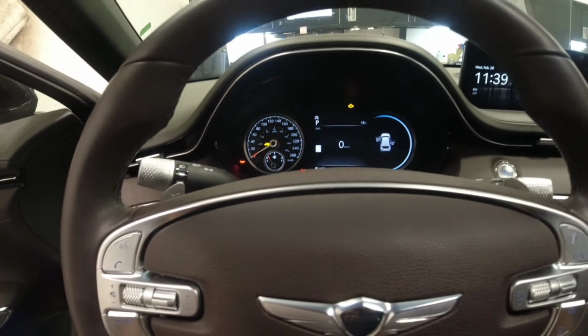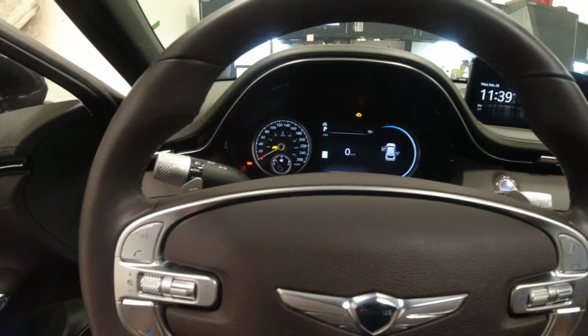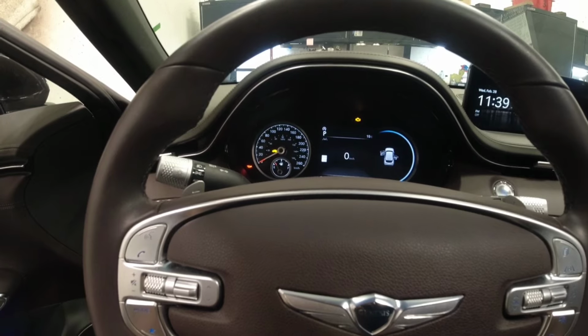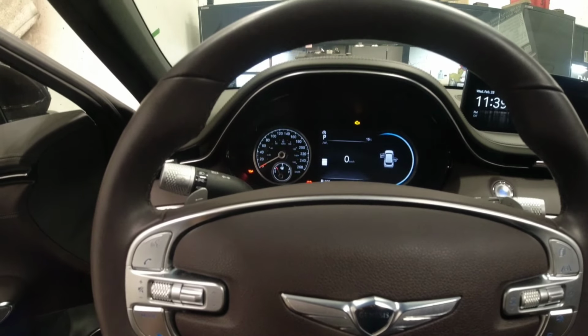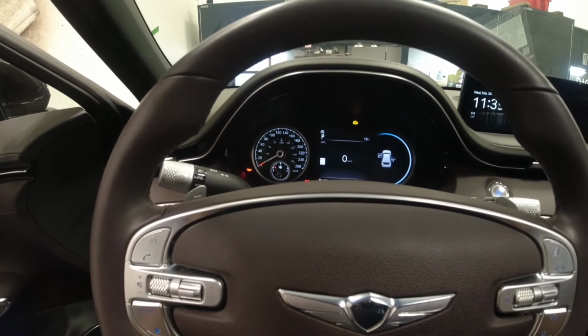So last time, every time we checked this vehicle, we thought that it's less than half, and every time we open the fuel pump, there's a lot of fuel there. So I'm gonna remove it because we're gonna transfer the fuel pump to the new tank. So I'm gonna remove those things there before I drop the whole fuel tank assembly.